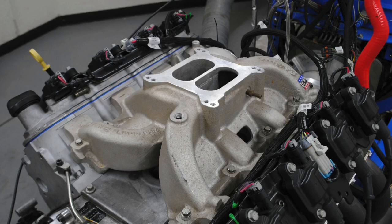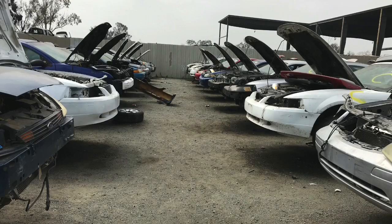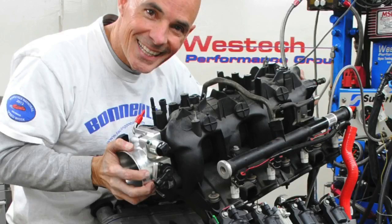What do you think about our comparison between the single plane intake and the dual plane intake on the little 4.8 liter? Here's the takeaway: if you're going to get the little 4.8 liter, definitely pick the dual plane intake — it is a much better choice for any kind of street operation. If you're going to rev this thing out to 9000 RPM then yeah, maybe look at a single plane, otherwise for any stock or mildly cammed 4.8 liter definitely pick the dual plane. But if you're going to go to the wrecking yard to get a motor, pick the bigger 5.3 liter — you'll be much happier, it makes more torque and more power. Even on the 5.3 I'd still pick a dual plane for almost any combination except the 9000 RPM stuff. Thanks for watching — make sure to like, share, subscribe, ring the bell, do all that stuff.